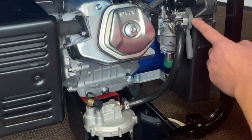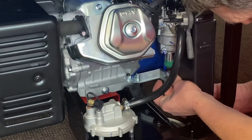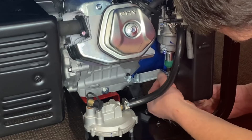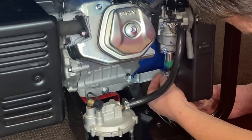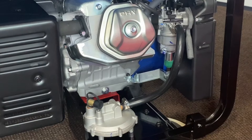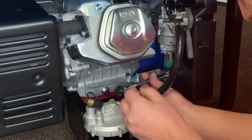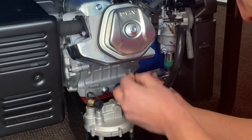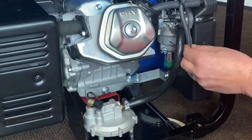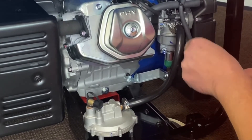When you put the slim adapter in there, you're pulling this away a little bit, so your vibration bracket down here has a gap. We'll supply a spacer — go ahead and put that spacer in and get that spun in there and locked down. Then we'll go ahead and install our line back on here, bring it back around and get that on there.